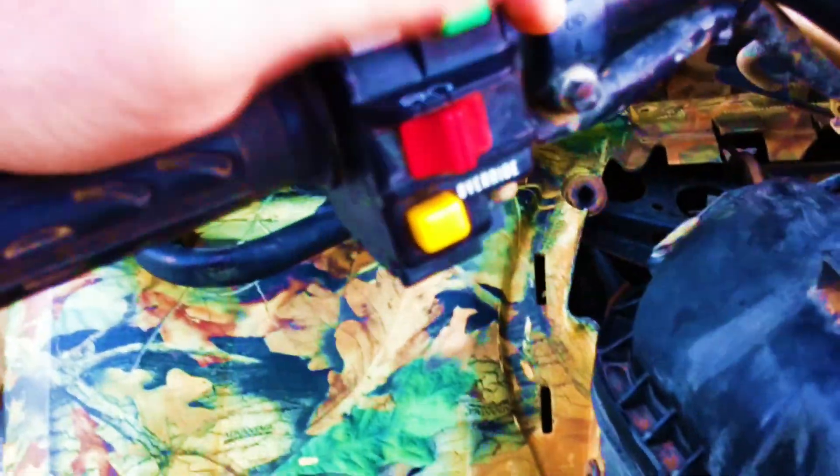This is the plug that comes to your kill switch, which will kill all the power to your bike, so it's going to have to remain in there. If it blows a fuse at that point, then you know that's where your issue is.